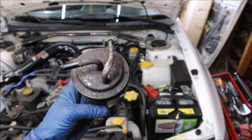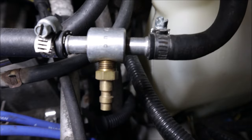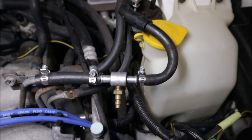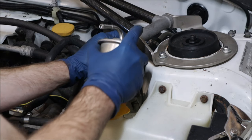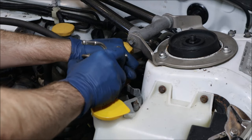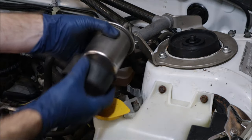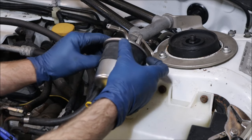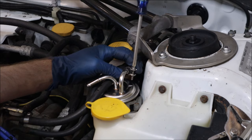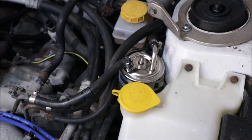I also had to get rid of the line they tapped into — they cut into it for a fuel pressure gauge or something. So I had to get rid of that T-fitting. That's just a new rubber hose. You're already halfway there when you're doing the fuel filter, so might as well throw a new hose on there. I'd like to go through and change all the fuel lines in this car because I just don't know how old they are. They seem okay, but some of them have nicks and gouges in them. That is a big safety concern for me. When I see fuel lines with nicks and plier marks on them, they might be leaking — they might be leaking soon.